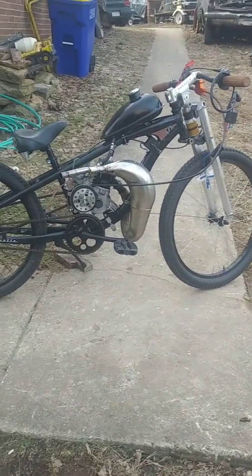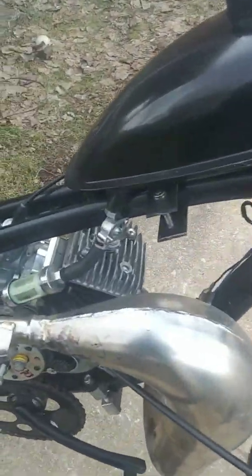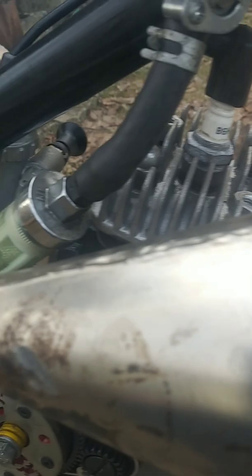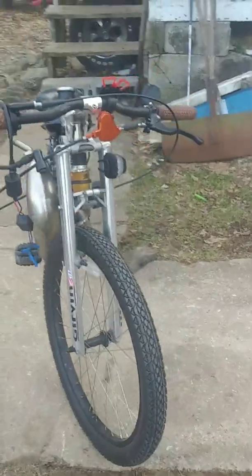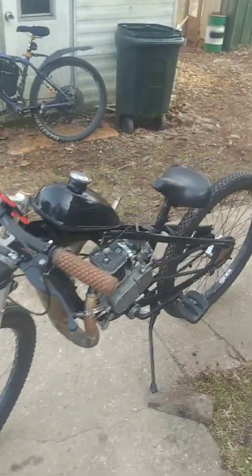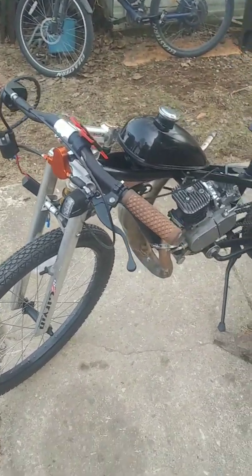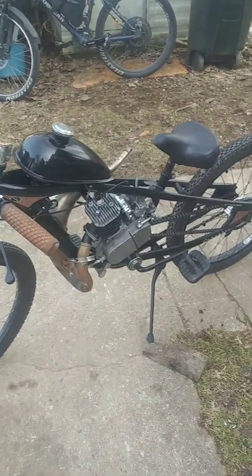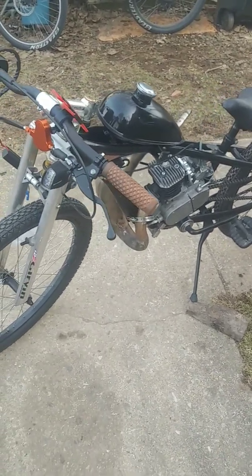Got lucky that an engine barely fits on it — it is a tight fit. The cylinder head is on sideways for this application. Carburetor is snugged up way in there. But this thing's a freaking monster. I've done 56 miles an hour on it, getting the clutch dialed in a little bit, doing some tuning on the carburetor. It seems like the ignition might not be keeping up in the high RPMs — I think I got around 10,000 to 10,500 RPM somewhere in that neighborhood, and that's about all she wrote.